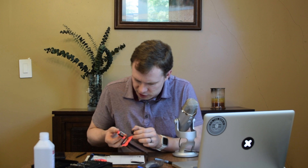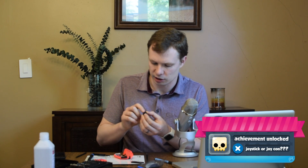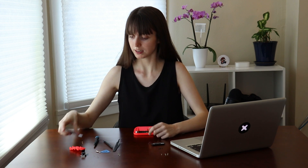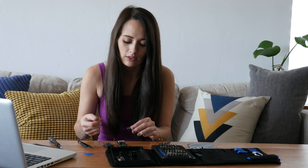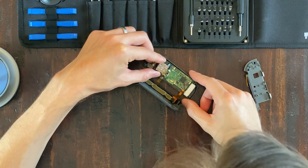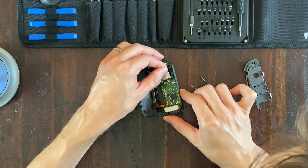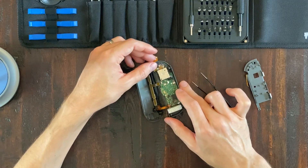There's a kind of plasticky papery rim on the inside of the Joy-Con that wants to grab onto the joystick and take a ride out with it. So now that I've got the old joystick removed, it's time to replace it with the new joystick. You really don't want to be touching any of the connectors and getting them dirty. If you do, clean them with a Q-tip and a little bit of rubbing alcohol. Sometimes it's easier to actually install the ribbon cable first — they can be a little tricky to manipulate into place. There's a little gasket around the joystick that's causing it to be a little stubborn, so you just have to finesse it through. And I think it's happy now — it's seated nice and flat.